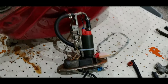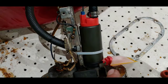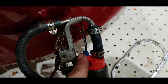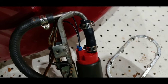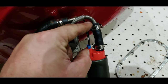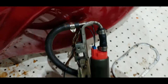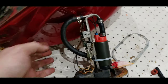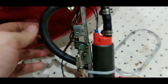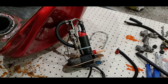It's all assembled. You can see the new fuel pump. I did zip tie the pump — it's pretty secure without the tie, but you know, security makes you feel better. The factory plug fit right back into this one, I didn't have to rewire anything. The bit of hose it came with was actually too long, so I had to trim it — just cut it to length, whatever you need. And remember the fuel line I said to buy extra? To loop it. So here's that loop — it goes down and hooks up to another line down there. That fuel filter used to be right here, now it's going to be outside the tank. I'm going to reassemble this thing.